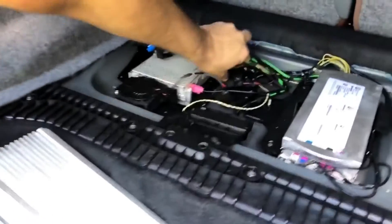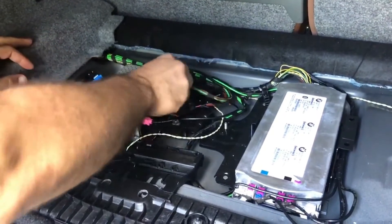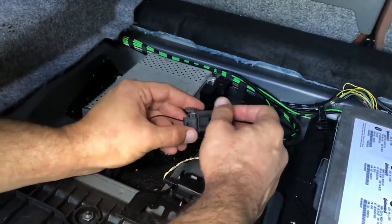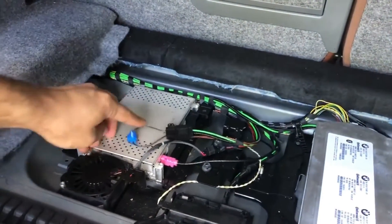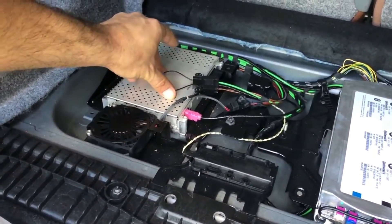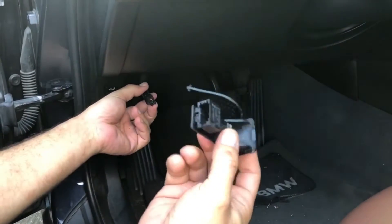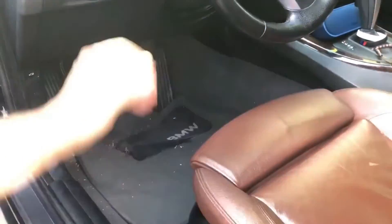The satellite tuner can be bypassed with a fiber optic loop. We're going to use this one — they sell it for $20 at any BMW dealer. We connect it to pretty much loop the line. Make sure you buy the jumper loop. The light is back! This is the termination loop — we connect it and turn on the radio.